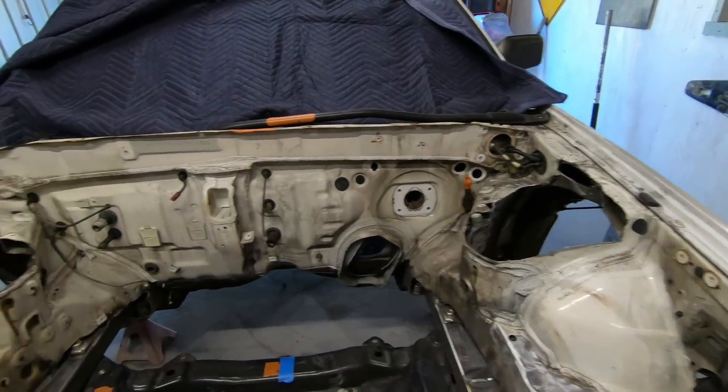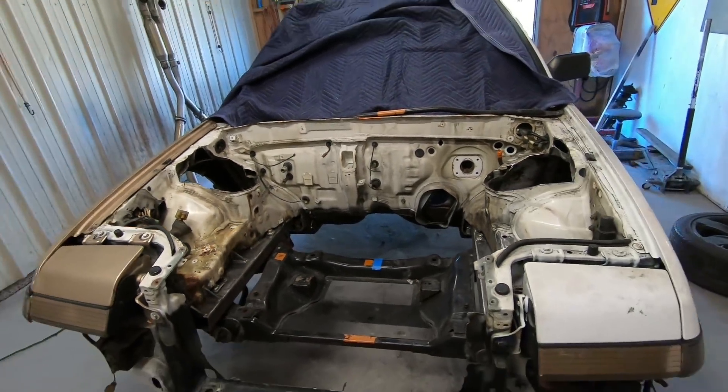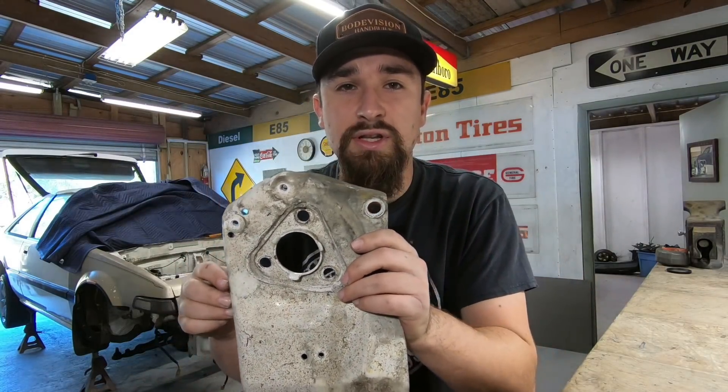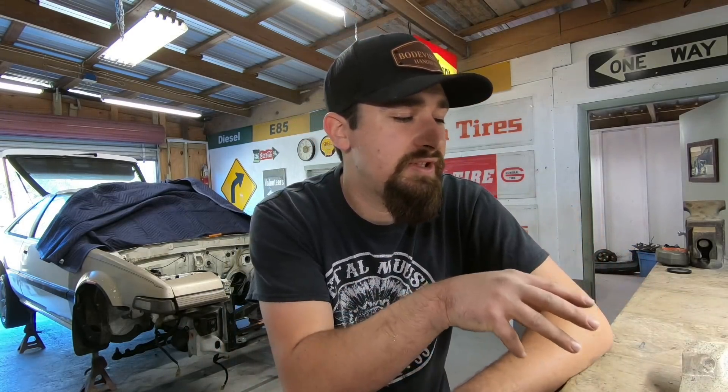We also need to get into these shock towers. The main reason I cut them out completely is one thing: suspension geometry. My original thought was I'd get custom coilovers and just use the three-bolt pattern here in the Accord — custom coilovers with a top section to meet the 88 Accord style and a bottom section as the McPherson style from the GTO. But that is not correct because of suspension geometry. What we're worried about is three things: toe, caster, and camber.